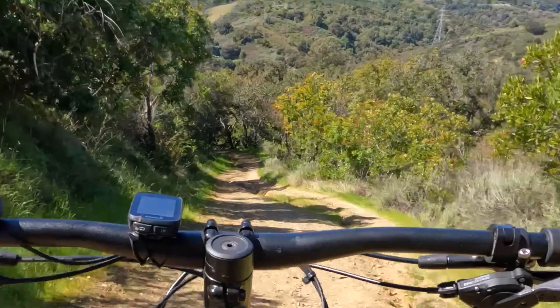Now let's talk about descending. I haven't been the greatest proponent of hardtail e-bikes because of the unsprung weight, but one thing this bike does is minimize weight with a smaller 400Wh battery. If you put a 700-800Wh battery on this it's going to be a bear. The aluminum frame with a lot of give is good and they've kept the weight down — some of my hardtail e-bikes at low cost are around 55 pounds and this one is about 46-47 pounds, so pretty good.